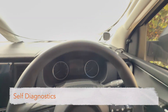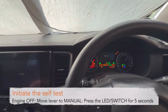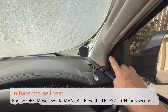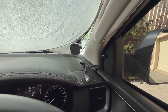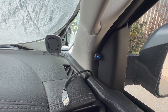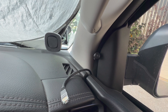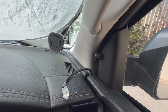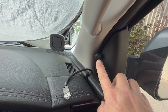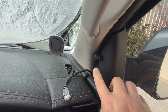I'm in a BT-50 here — it's the Mazda logo. To run self diagnostics, turn the ignition on, move the shift lever into the manual position, then hold the button and count to five. You can see the light will come on and you'll soon hear a click — that's a relay in the control unit. It runs a series of six tests and when the light goes off it's finished. If there was a fault, the light would flash a number of times, then pause, then flash again. The number of flashes indicates which test failed, and you can refer to the installation booklet for reasons why that might be.